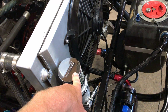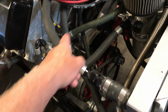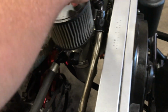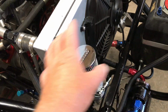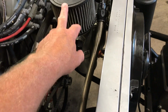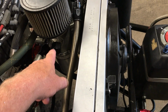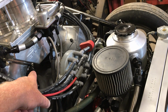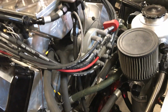So now I'm trying something different again. I've got the vacuum pump plumbed in to this reservoir with the big breather on it, and I got the dry sump going to the little tank, because when I had them separated there was hardly anything in this one from the dry sump. So now that we have a bigger reservoir for the vacuum pump, I'm hoping that we can make a full run without this thing spewing over. And then I've taken it from the intake valley. I haven't got the intake off, so I don't know what kind of baffle is under there.